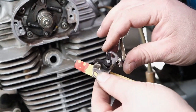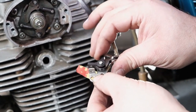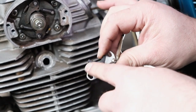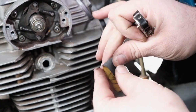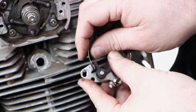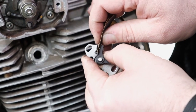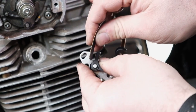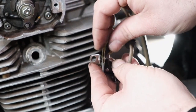This set of points is used but in good shape, so we can use them again. I recommend taking the rocker off the shaft and lubricating it with some grease. We're also going to clean the contacts — this is where the electricity actually flows, between that little disc there and that disc there. The easy way to do that is to take some sandpaper, fold it in half, and get it in between the two contacts. Work the paper back and forth and you'll get the dirt and corrosion off. This is ignition system 101 — just keep going until you get it nice and clean.